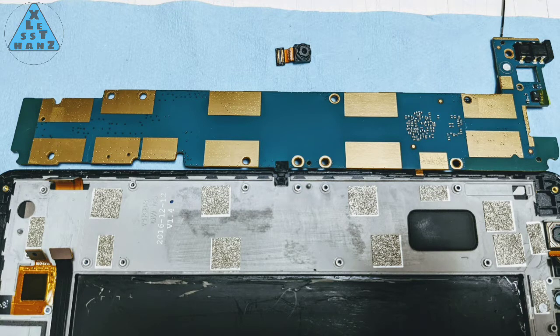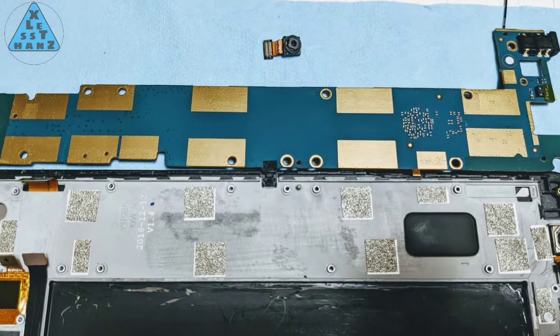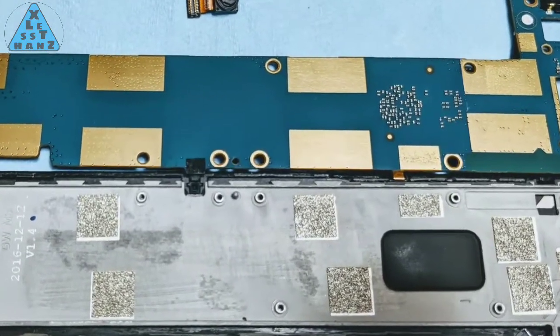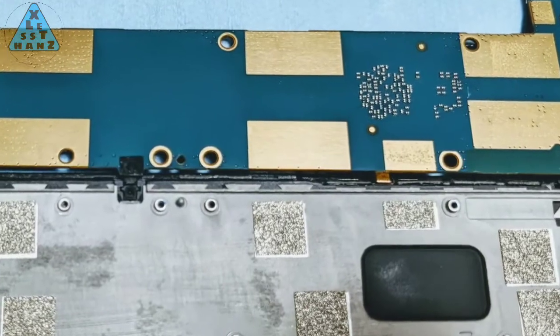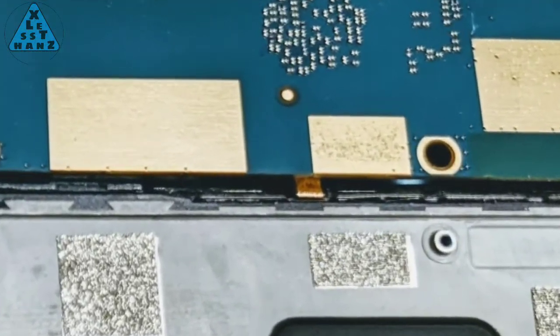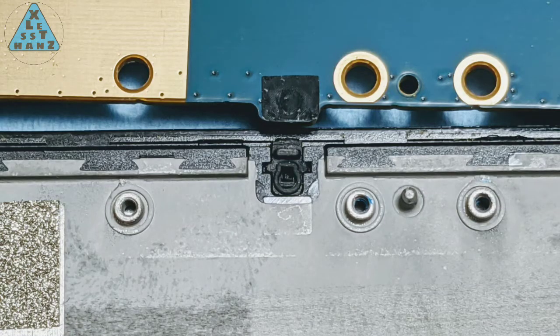In this close-up, there are two other items here you should be aware of. The first is a cable that connects to the motherboard. Be cautious of this one, it seems to be glued in place to the motherboard connector, and with that, I can't remove the motherboard. I have to leave it dangling. Second is the black rubber part. If you get this far with the teardown, this piece will fall out. I think it's sticking to the motherboard as you flip it over. This photo should help you put it back in its proper orientation.